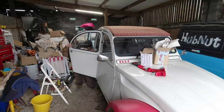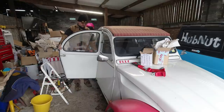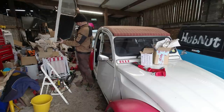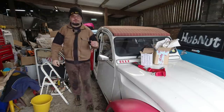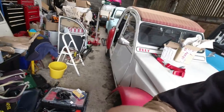I can undo this little clip down here — on Ellie there's a draft strip that attaches to the door and sort of locks it to the body, but I haven't got that fitted, so I can just lift the rear doors off like that, which makes access a lot better. I do love 2CVs — and not just for that reason, but that is one of them — after you've worked on something like the Rover.